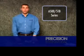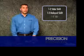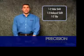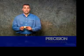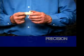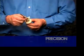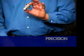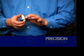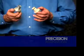Today we're going to address two separate issues on the 500 and 518 series of transmissions. One is a 1-2 slide, delayed shift, or 1-2 slip that we just can't eliminate no matter what we do — adjusting the band, changing the band — and we still can't get that 1-2 shift right. The issue is the 1-2 accumulator piston: the factory made it out of soft plastic with Teflon scarf-cut rings, and it tends to crack down inside where we can't see it, causing a leak in the circuit. Southeast Tools has tooled up and made replacement pistons out of aluminum with butt-cut metal rings which drop right into the 500 and 518 series and create a much better 1-2 shift apply. We highly recommend these on any service work, as you never can tell when this plastic piston is going to crack — the metal rings seal very nicely in the bores.